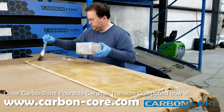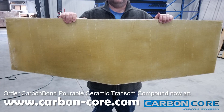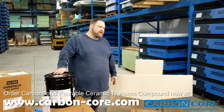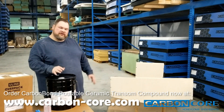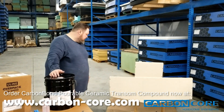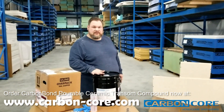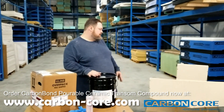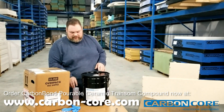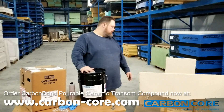We just got done fiberglassing the inside skin of our transom. You'll want to make sure all holes and cracks are sealed. This mixture has the consistency of about a milkshake. If you can't remove all the splinters of the old plywood, that's okay — this product will envelop it and form a bond around those things. However, it does need to be completely dry, so let it air dry if needed. This is the MEKP catalyst — note that MEKP is different from MEK. You may think you have some MEK in the garage, but that's not what you want. MEKP is the only thing to use.